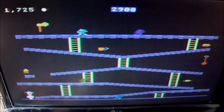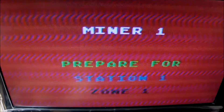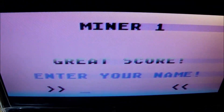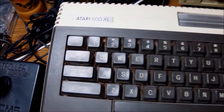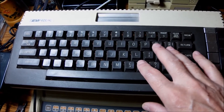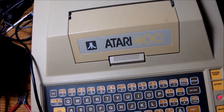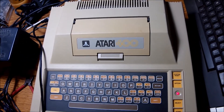It would be great to find several tapes with games for the Atari 8-bit series. Furthermore, I need to test the ability to load games from the cassette player also on the Atari XL series machines. And hopefully I could get my hands on the 800 model, which is the second 8-bit Atari series machine from that era and used to have 48 KB of RAM. The absolute successor to the 400 model is the 600 XL — the one you can see here — which has the same cartridge port, a decent keyboard, and embedded BASIC in ROM, but the same 16 KB of RAM like the 400. We'll get back to that as well, and hopefully we'll have the chance to go over more models, more games, and another review under the hood presenting the circuitry and everything.